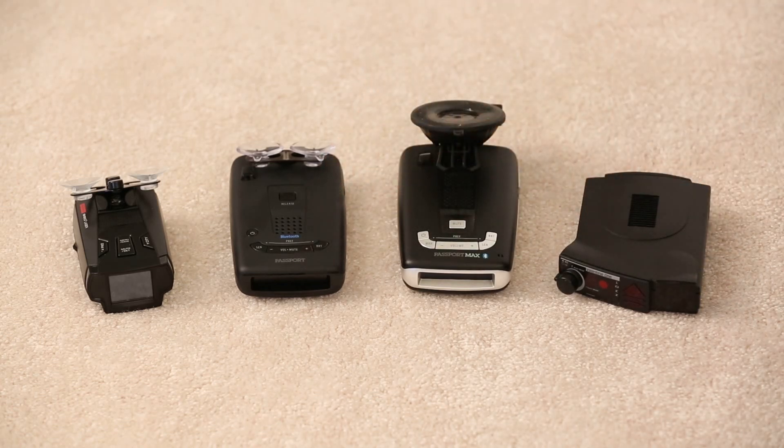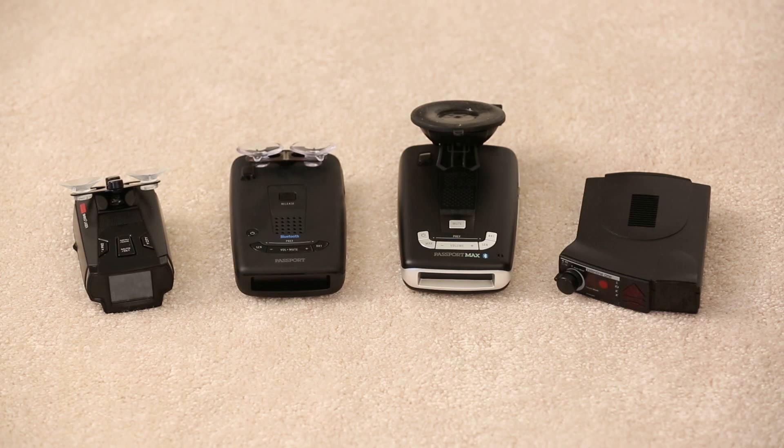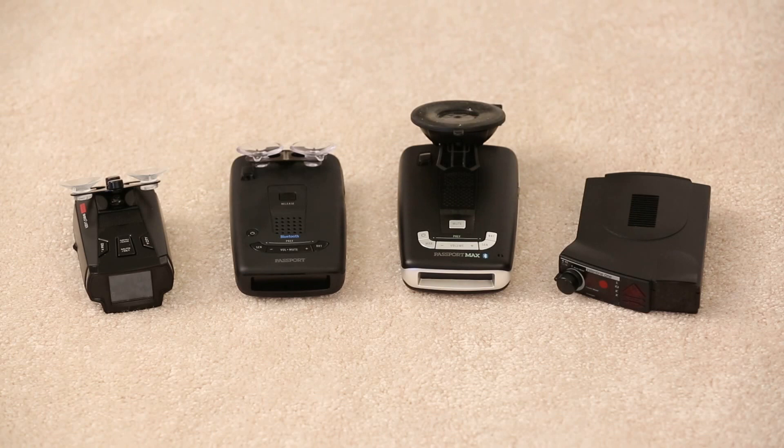Like some of the other detectors, it relies on your phone for GPS speeds, and it can actually display your speed on screen, but only when paired with your phone. If you don't have that, you've got no directional information. The way it accomplishes low-speed muting — you'd think it would just base it off GPS and mute signals below a certain speed. It doesn't do that. The Cobra implementation is called IntelliMute, and the idea is it'll actually monitor the RPM speed, the revs of the engine. When your engine is at low RPMs, it assumes you're traveling at low speeds and mutes. When your engine starts revving hard, independent of what speed you're going, it would then begin alerting.